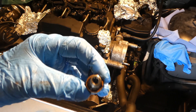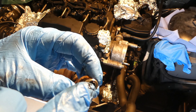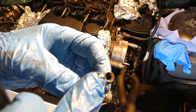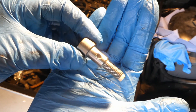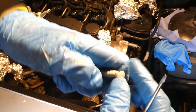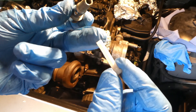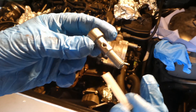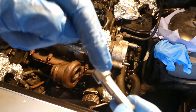Some people just remove that filter altogether, but if there's any crud or small bits and pieces, they'll end up in the turbo on the shaft. I'm kind of torn whether I should keep it or replace it — you can just wash it and put it back. This is the banjo bolt of the new design. It's got a plastic element, and that's really the new design. Let me open it.